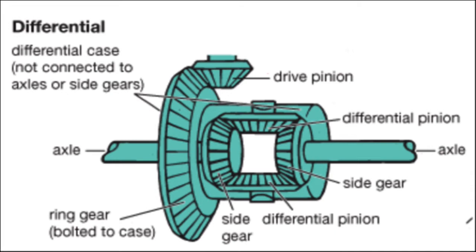This is where you have a main gear that drives a series of other gears, or ring gears, the planet gears, so that you can have a single power source and have either different outputs or a single output or varied outputs to the rear. The earliest cars had them, all the way from the beginning. The cars that didn't have differentials were those that had a single wheel driving to the ground. Not as common on four-wheeled vehicles. Usually, if you're going to have a four-wheeled vehicle with the rear wheels being driven, there's going to be a differential. Sometimes, though, there may only be one wheel to the rear being driven, in which case there's not going to be a differential on it.